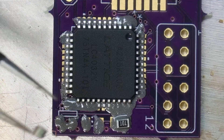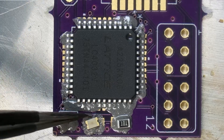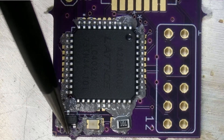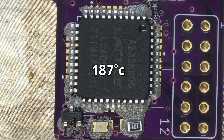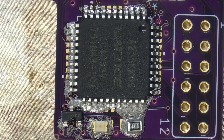Now we'll be placing our resistor and LED diode — the orientation is by the green bar on the left hand side — and of course the transistor. Now we're ready to place the Jafar on our preheater. I have it set for 195°C; you could probably get away with 187°C. This process will take a couple of minutes to preheat and for the liquid solder to start melting.